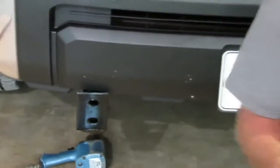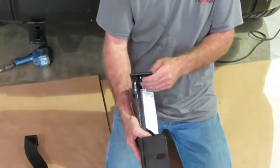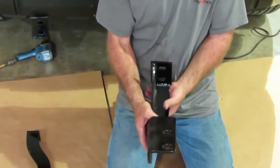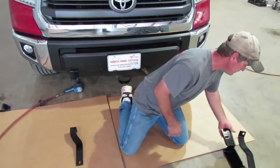We're going to show you the bolts here in just a second. The very first bolt that we're going to put in — we're going to put both bolts in, but you're only going to snug one. When we put the grille guard up there and tighten that, it allows it to align. It helps you get it square underneath, and then you can tighten both of them after the grille guard is hung. The flat side of the bracket goes to the outside of the vehicle.